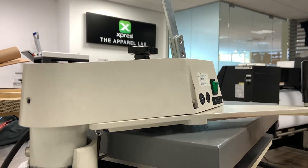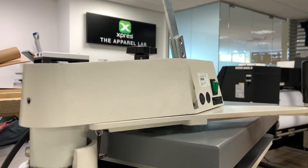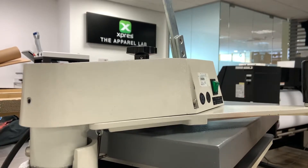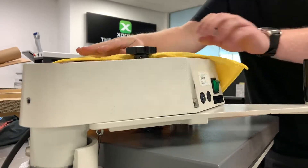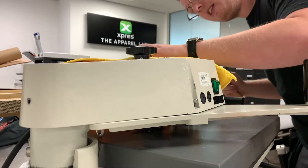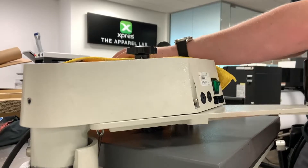The really important thing when trying to get this split pin out — I hope we can see that quite clearly, see this silver split pin there — is to try and hit it from both sides. First thing, we're going to try from this side, so I'm going to put over my cloth, clamp the handle down so the machine doesn't rotate or swing, and I'm just going to try and pop the split pin out this way.